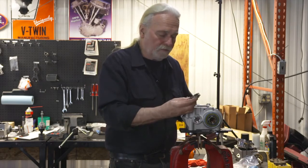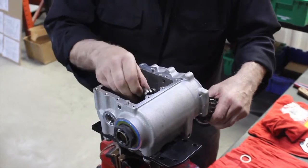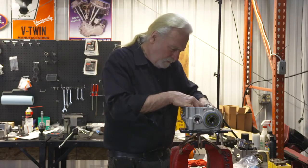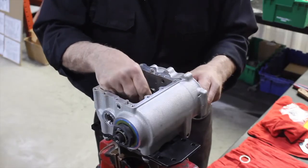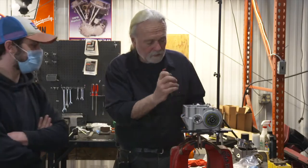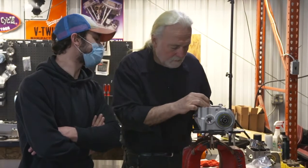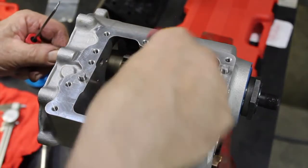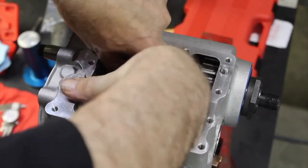Now our sliding shifter clutch, watching our cut edge, and everything goes through at one time, as you see here. You have to kind of look at what you're doing here. You're going to bring this all across everything. The retaining ring with the thrust washer. Third gear coming on as such. Here's our thrust washer. As you can see, I'm going to line that up with the slots. This is all a little tricky here.